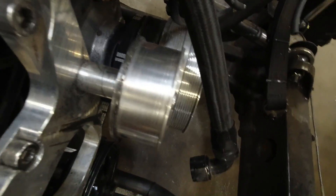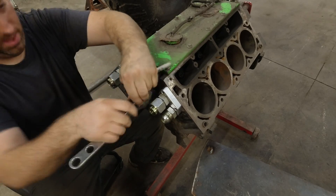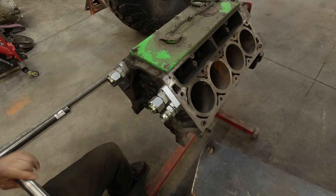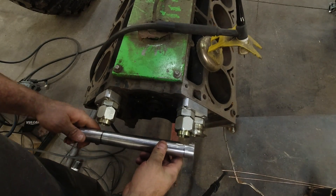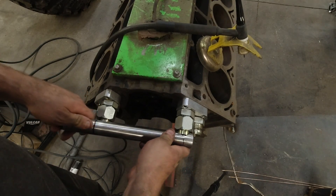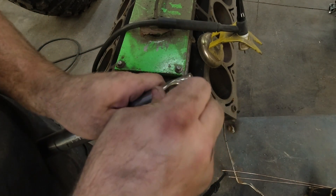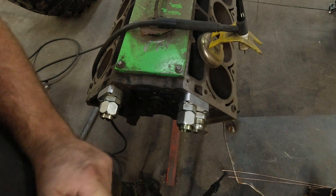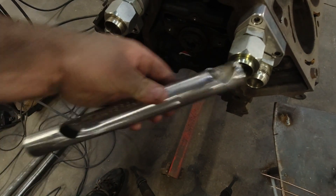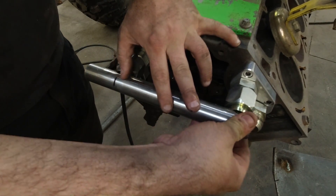I have one fit hose there and the other hose is next to it that normally goes down to the thermostat. But based on how this is set up, I'm probably going to figure out how to put them both right here. We got one hole. Believe it or not, that was a little more difficult than you would have thought, but it actually fits in there pretty good. I took a test piece and it has a nice fit there, so that would be perfect to weld that up. Now I just got to figure out how to get it lined up for the second one. I got our second hole drilled and I think our fit's pretty good — it is definitely snug.